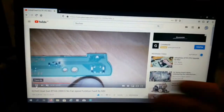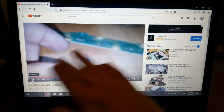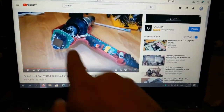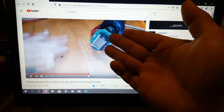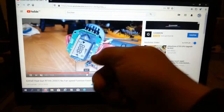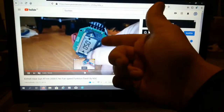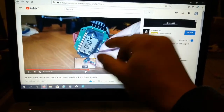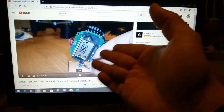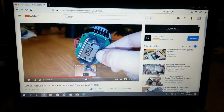A lot of people just throw their devices away because they think they are broken, but it's not — it's just a problem with the special paint on the rubber contacts. I repaired mine with other methods and it's still working. The replacement rubber contacts will of course last longer than the paint, since they use metal or copper contacts. But the paint will still hold for several years and it's better than nothing, and it's really cheap.